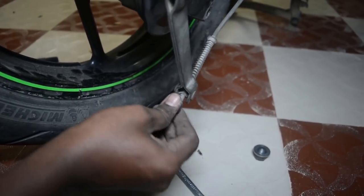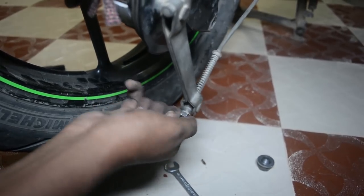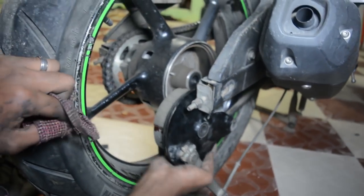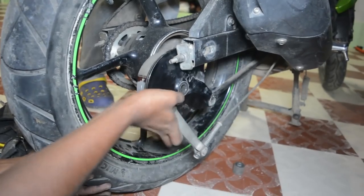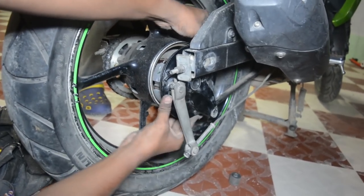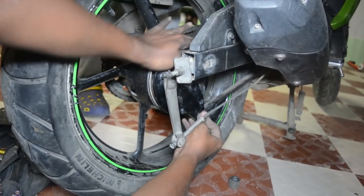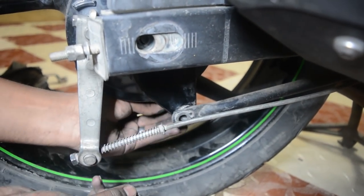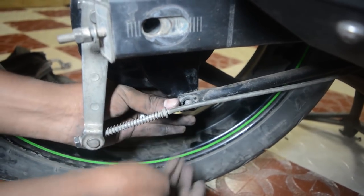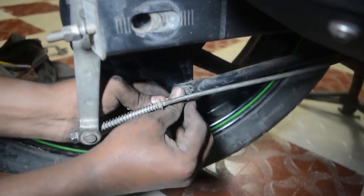A sign that the brake shoe has worn out is the marking given on the brake drum — there will be an arrow mark on the brake shoe housing, which you can see near my palm. Insert the brake shoe into the brake drum, then fasten the brake shoe housing to the torque arm. I call it the torque arm because it takes and resists the braking torque, holding the brake shoe housing in place.